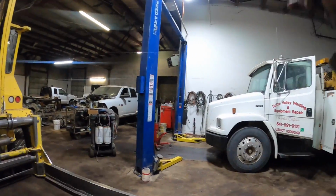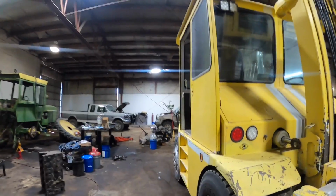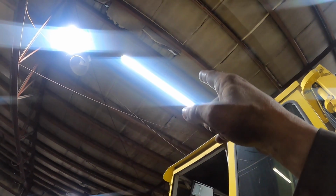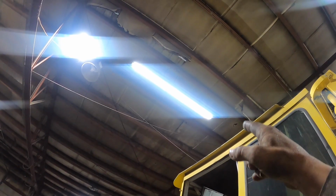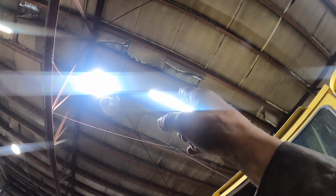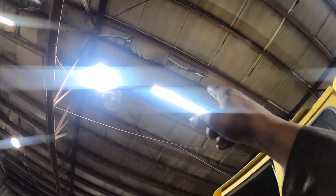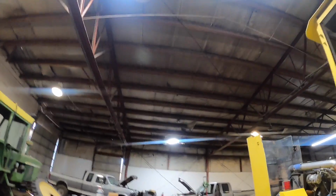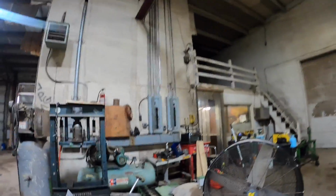I've got these changed out and wired. I've installed 4 high bays, and I've wired around. You have to take these ballasts loose. Well, you don't have to take them loose. You can leave them in there and just cut the wires. And basically, you just take your neutral wire and go across the ballast where it was wired around it, and wire to the other end, and take your hot lead and go to the other end on these single pin LED lights, the old style fluorescents. And I've got another one put in over there, and I can't believe the difference it made in here. Finally, I got a good enough deal.